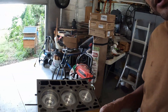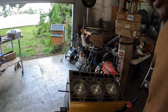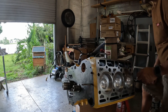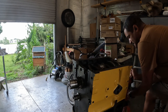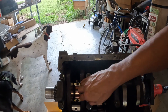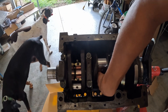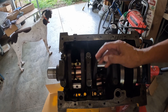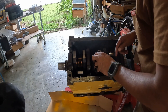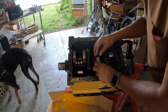Got the pistons in — they're all in. They're at different heights because I still have to hook them up to the crankshaft. I'm going to spin this thing around, get them hooked up to the crankshaft, then re-torque the main caps. Here's the connecting rods, and this is the journal where they need to hook up to. I'm going to move the crank back and forth to seat them — if I push too far the pistons will come out and I'll have to re-seat the rings. Making sure my dots are the same. I'm not tightening these up right now, just snugging them down some.